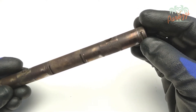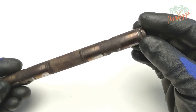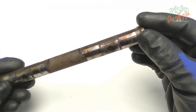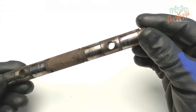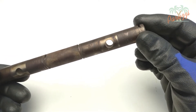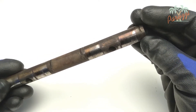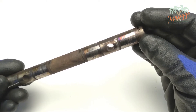This is another rocker shaft where overheating has left marks. The purple-blue discoloration of the metal indicates excessive temperatures. The metal structure has been affected and will lose its original characteristics. The rocker shaft will have been weakened by the heat and is therefore no longer serviceable.